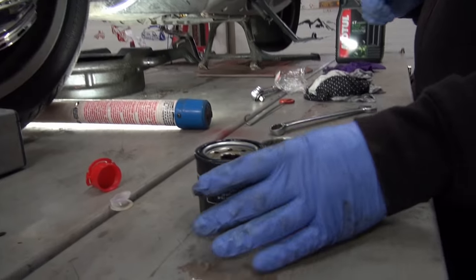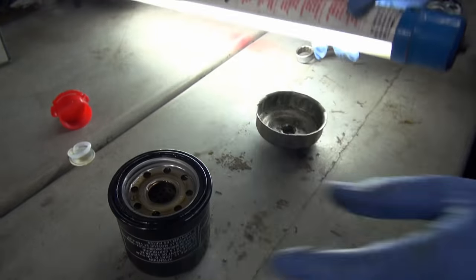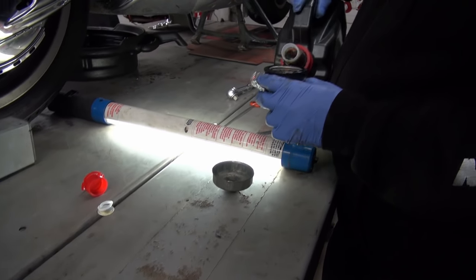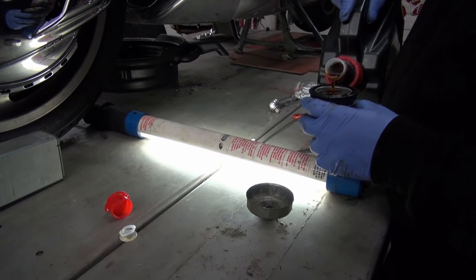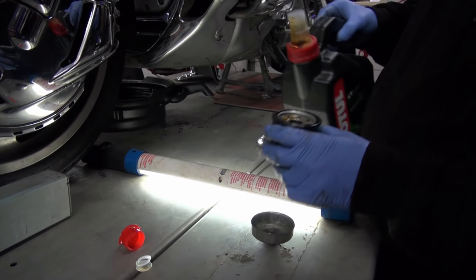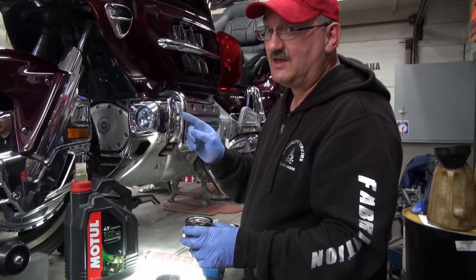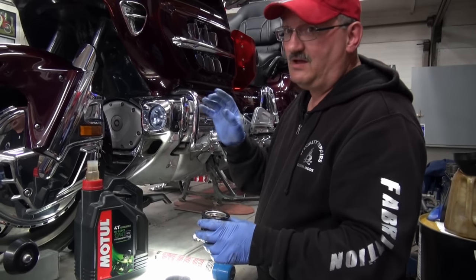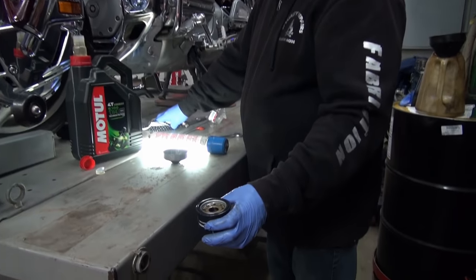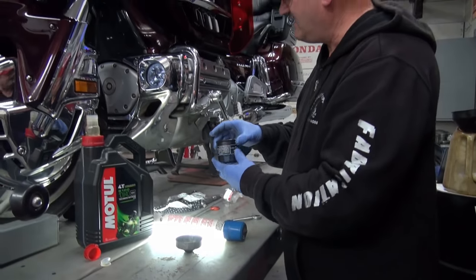Now all the oil that I put in that filter, just look. Oh, yeah. It's empty again. Yes. An oil filter takes a lot of oil. Gee, it really soaks up. Yeah. So, you know, it goes to show, if you put that oil filter on dry, how long it would take that motor to pump that filter up. True. While it's pumping that filter up, there's other things waiting to get oil. And it's saying, I need oil. At least this way here, you're going to get oil. Even now you can see, look, I filled it up again, and it's still half full. That's amazing. Yeah, so it absorbs a lot of oil, right?